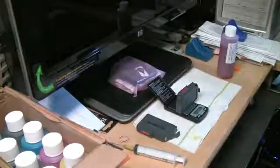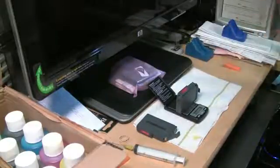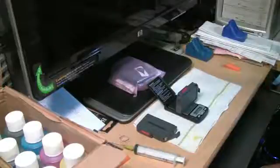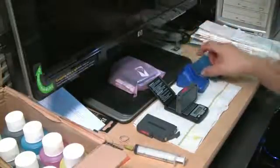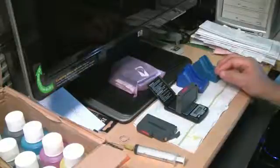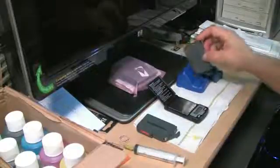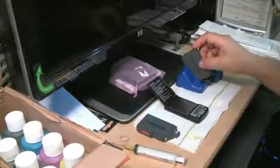I have set up the photo magenta cartridge so that I can refill it. Now as far as resetting these cartridges, most CLI-8 resetters will work on 8 of the 10 colors, except for photo black and gray, as many of you already know. There are many types of cartridge resetters — I have two very well-known ones here. The PGI-9s have a different design on the exit nozzle and they actually interfere, so no contact takes place, because the protrusion here causes the cartridge to tilt forward and doesn't allow it to contact the pins.